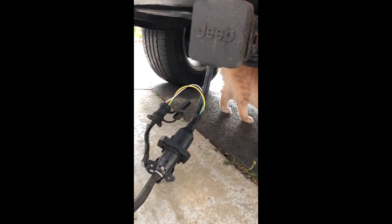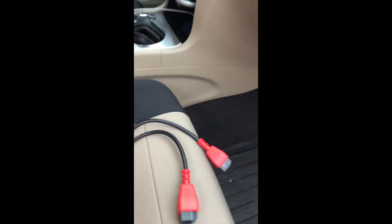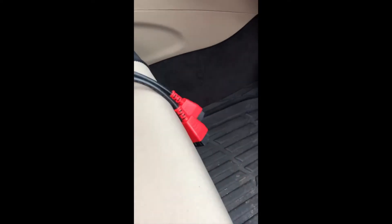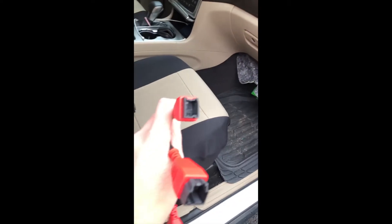The wiring I found was all under here. I installed the hitch — the wiring was under here, it just wasn't connected. So I bought the connector and I'm trying to wire it up, but Chrysler does this amazing thing where they don't allow you to write to the computer and they put the trailer settings in the computer. I wasn't able to do it with just my normal OBD2, which I can do everything on my 2011 Wrangler with, but not on this 2018 Jeep Grand Cherokee.